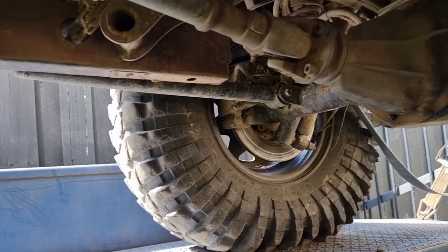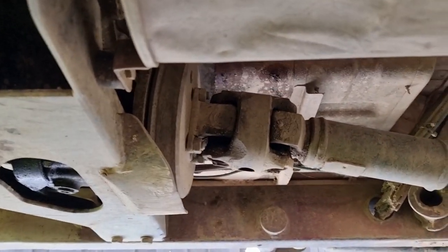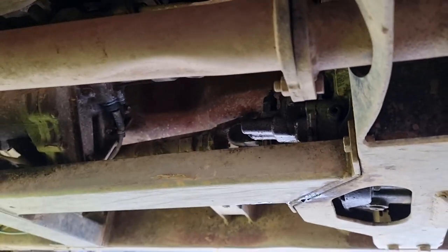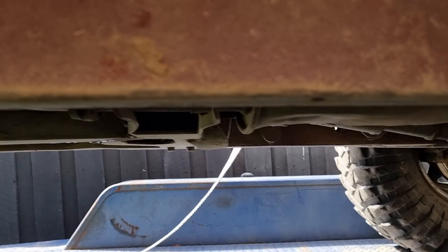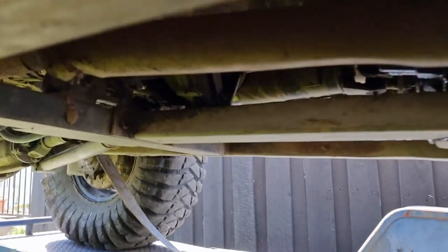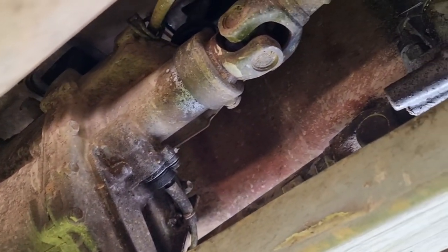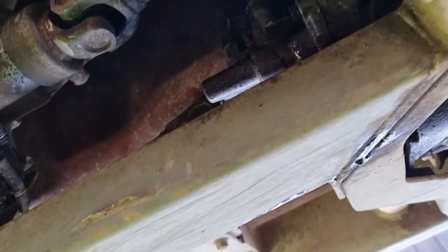Looks like it needs brake pads. It's okay. Now it runs a short Hilux double cardan shaft, Sierra transfer case on this big cradle. If I can show you guys, see this flat pan underneath. It's quite amazing. Up here, that's the Vitara transfer case. It runs a short jack shaft. So basically it's double transfer, or twin transfer, sorry.